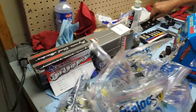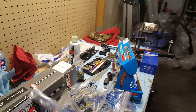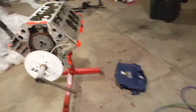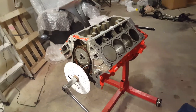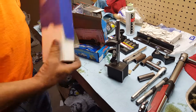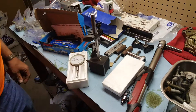It is a custom ground cam. When Tim talked me into doing this — it's usually for the better when he does. He talked me into it because you don't spend the kind of money I spent putting this engine together and not take the time to degree the cam. So we're going to go ahead and do that, get the dial indicator hooked up. Tim brought all this from his shop and then I'll turn the video back on and we'll go from there.